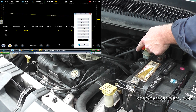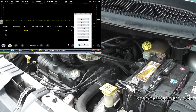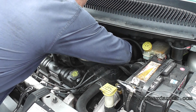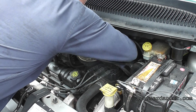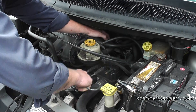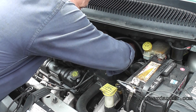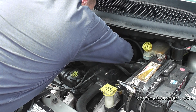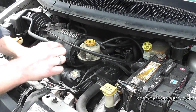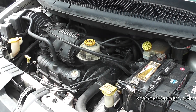Here's the question: is it a plug or is it the wire? Pretty simple test — we just move the plug wire. This doesn't always work easily, but it does on this vehicle. I'm moving this number five plug wire — and these are new too, so it's kind of hard to make this call on new parts. I'm going to move it to number six up front because it's a short plug wire. I'll put the number six plug wire in the back. This is my suspect plug wire — we're going to take our measurements now.